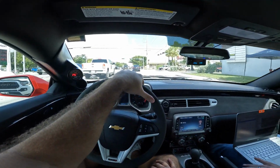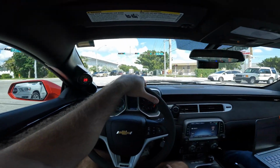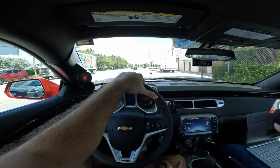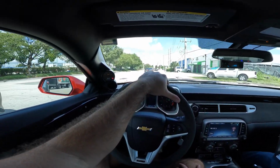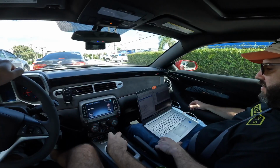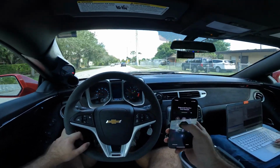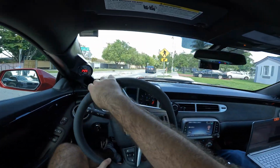So I'm looking at the fuel trims. Fuel trims is basically based on the O2. I think we talked about it last time, on the C6. It's seeing how much the O2 sensors are reading and pulling, either pulling fuel out if it's rich or adding additional fuel if it's lean. It looks to be pretty good, actually on spec. IAT's reading good too. IAT is intake air temp.